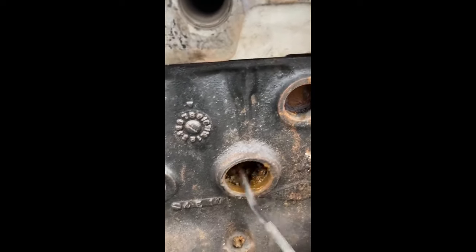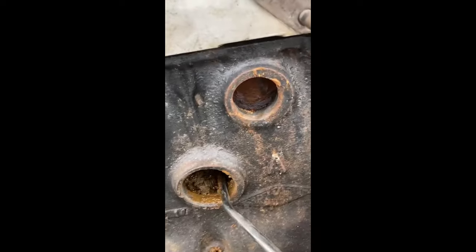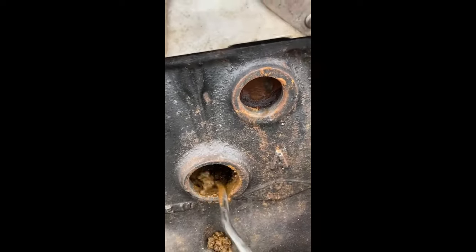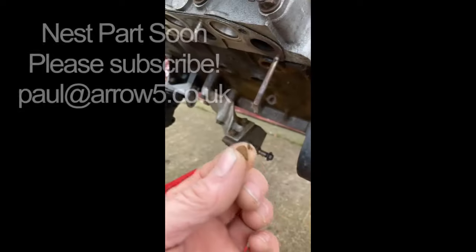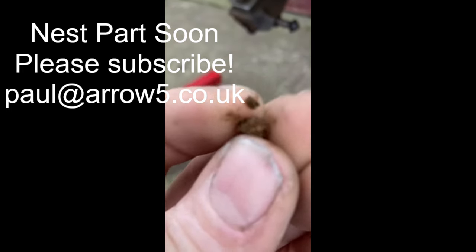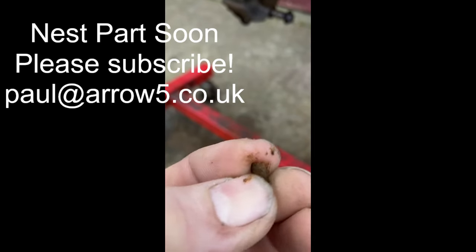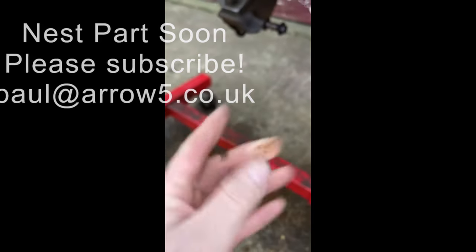You can't flush it out when it's in the car — you've got to take all the core plugs out and dig it out. Look at that — all sand. You've got to pull out the airlines and you still get these little grains popping out, trapped in there: old sand and cast material and stuff.